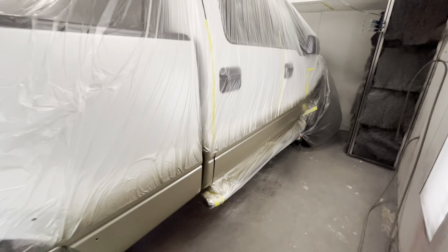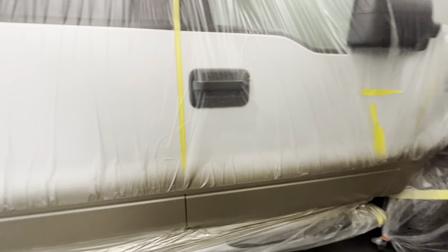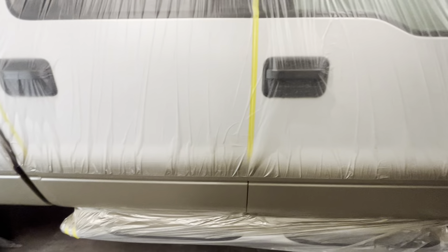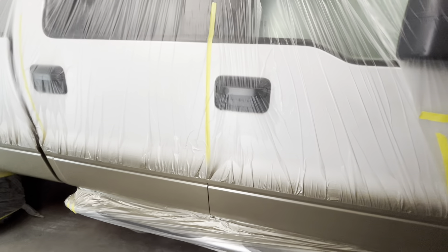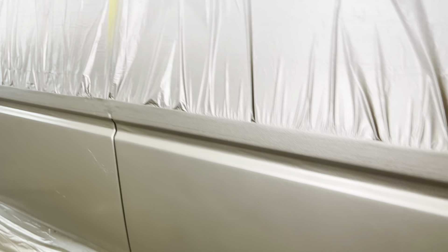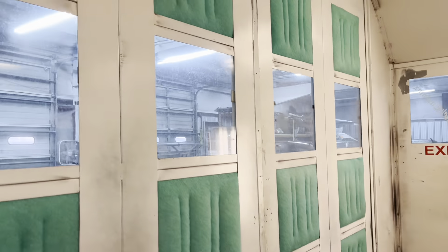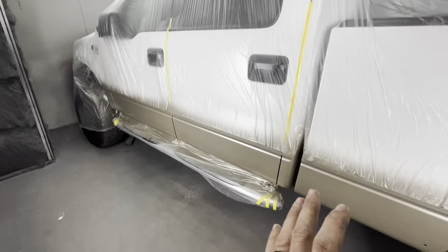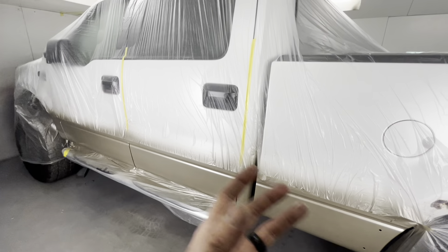We are painting this truck and laying our two-tone, and I wanted to stop because this video is going to take a turn — we now have issues in the paint. Somebody put a really crappy paint job on here, more than likely spray paint, and now the areas where the primer was a little thin, it's cutting through and wrinkling up the stuff underneath. Normally you get this when you try to paint over spray paint — that's why we primed all of this. But there's a handful of areas having issues.